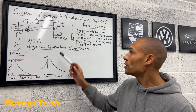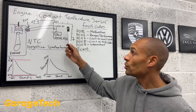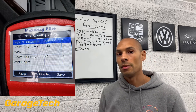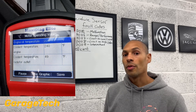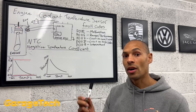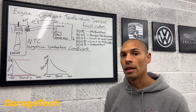What the engine ECU will do is cross-reference the engine coolant temperature sensor with other things like your intake air temperature sensor. You might have an oil temperature sensor. It's probably got another engine temperature sensor somewhere — maybe inside the block or inside the cylinder head — but it might not be in contact with the actual coolant itself, though it's still a temperature sensor.